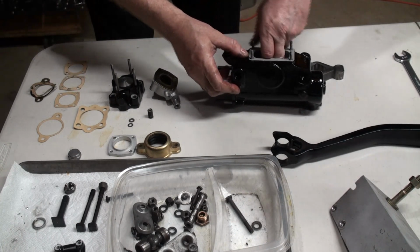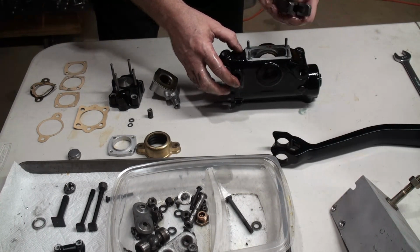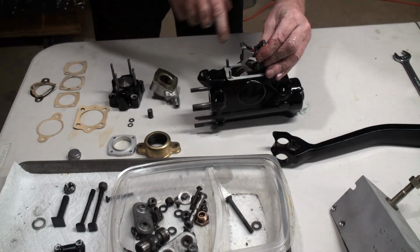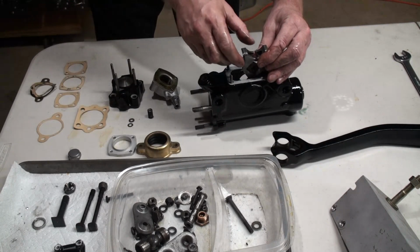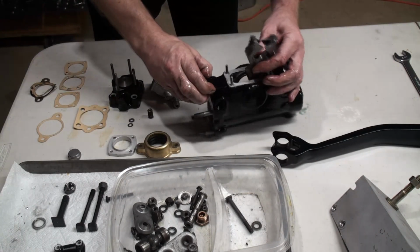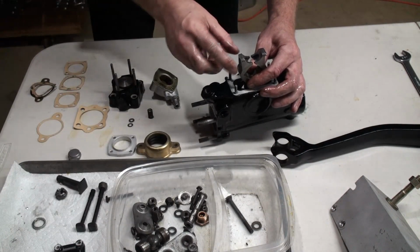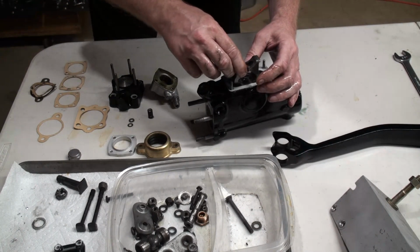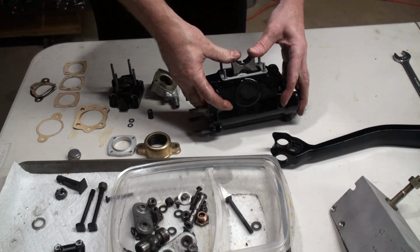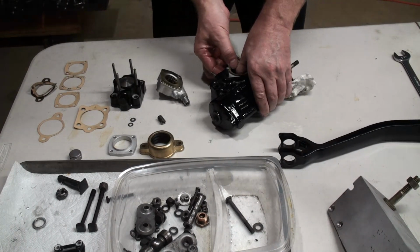So then we get our opening in position there. And then we put in our connecting rod. Now on this one, there's more room on the oil fill side here. So that's the side you want to have the nut on for the bolt that goes through here. So just keep that in mind. So then we get this all lined up. We can snap it in. So now we have the connecting rod in. Just double check that things feel free and all.